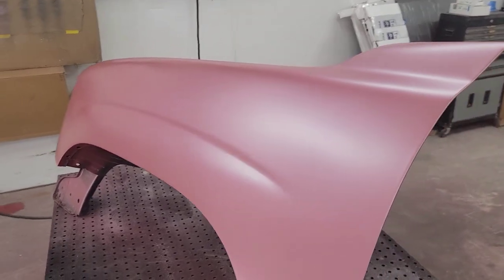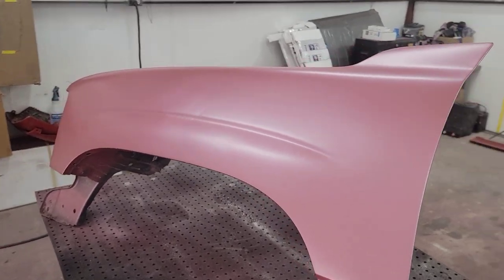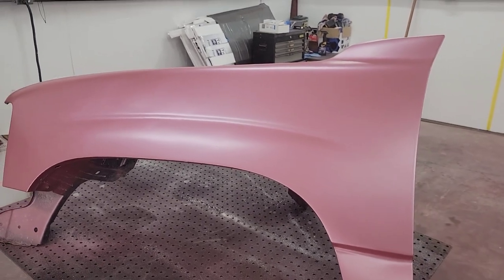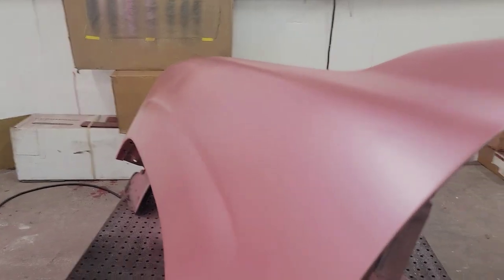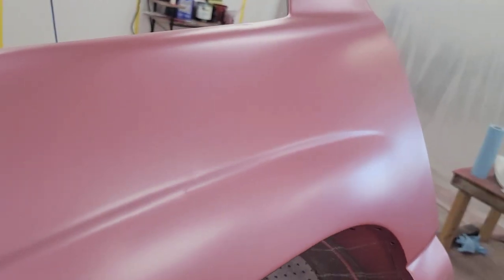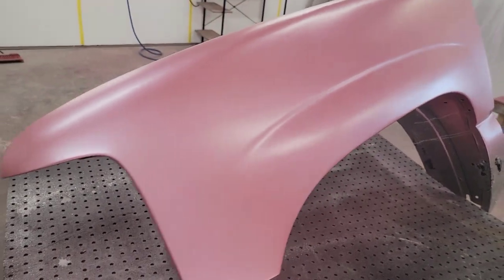All right, guys, so this is 3 coats, and this is going to be our ground coat, like our base coat. So right here, this is a 4-to-1 mix between Galaxy Silver, 4 parts Galaxy Silver, and 1 part of the Victory Red. So these are just paints that I already had right here. I mean, even just for a base coat, this is a beautiful color. I have a pink Mitsubishi, so if I ever wanted to paint with automotive paints, this is a beautiful color just like that.